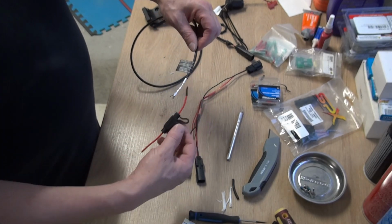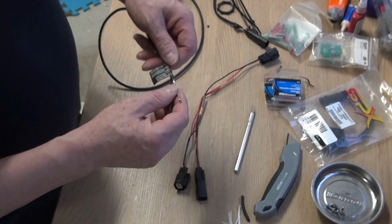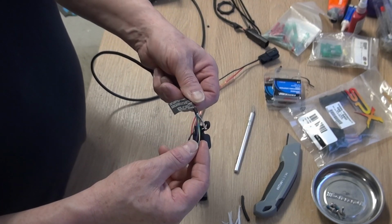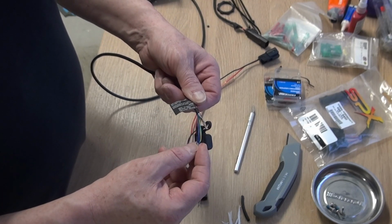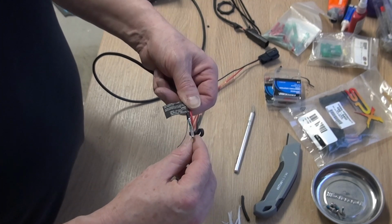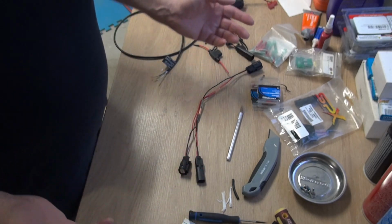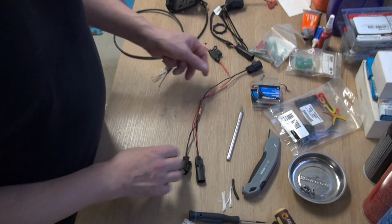So I'm going to have to put this fuse in here, as well as a black wire, and the red and blacks are in here. These cables, the purple and the green, are for the audio, and the red, green, and the blue are all for the serial data connection, which none of that I'm using. I'm only using the red and black to get the power.